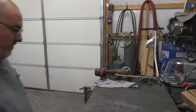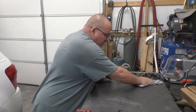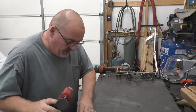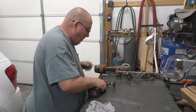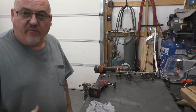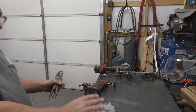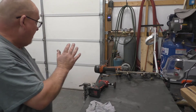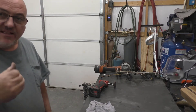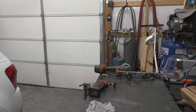One thing that is good — if you know somebody, or even if you're doing it yourself, you can still find a shop that has a commercial parts washer and have them clean your parts. The biggest advantage is your parts will come out without an oily film — they're basically dry. Then we can take compressed air after everything's cleaned up and blow it all off, and nothing will stick because there's no oily film. Just an idea.